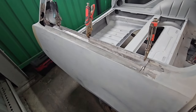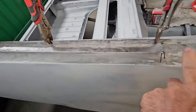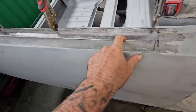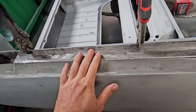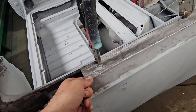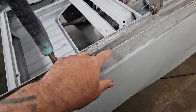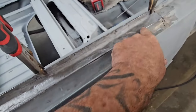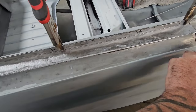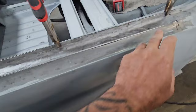Got my piece measured up here - got a pie cut each section to keep it straight. I had to stop a crack that was just kept forming along this ridge line here. So I've done a 90 degree bend here and about a 45 degree on this edge because I want to keep it as strong as possible. This bit here is a little bit higher but once I trim those off and tack weld that up, spot weld all in here, then just start working my way through.